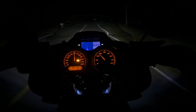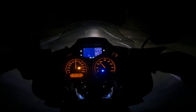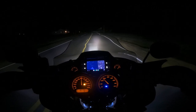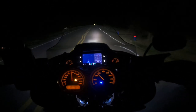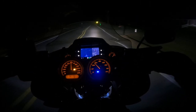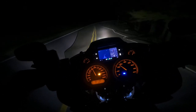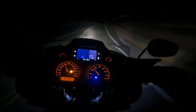The Baja's got a little bit more rugged build. I'm about to flip on the high beam, and you'll really see the difference. You can see there's that little square — that's from the Jeep light. And this round part, a little bit forward, would be the Baja. Which is somewhat intentional — I've been fiddling with the adjustment because I want the Baja to aim more forward, more long-distance throw. And I wanted the Jeep light to be more of a general fog-like or area-like light. So it's kind of an intentional setup, putting two different lights up there.